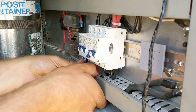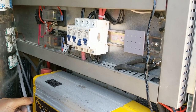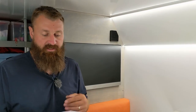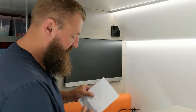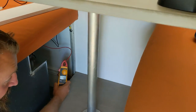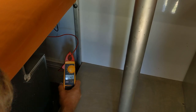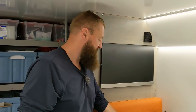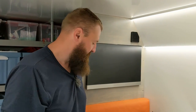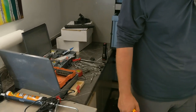Cover all the wires back up. Now checking the user's manual — the Drawer 85 should be pulling 6 amps. Let's check that with our Fluke current clamp on the positive power wire: it's pulling 4.5 amps. We've just turned it on, so that should be approximately the highest current it will pull. The manual does say to put a 15-amp fuse in, so I'll run out and change that, then clean up this disaster zone, and then we'll get Kara to give you a final review.